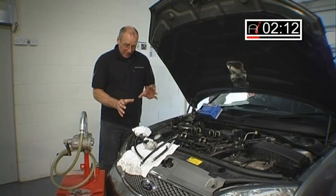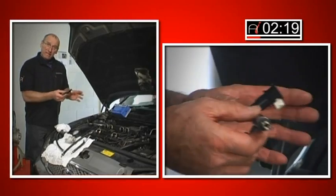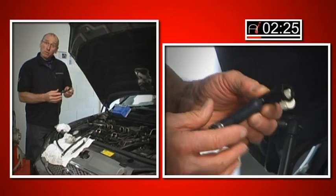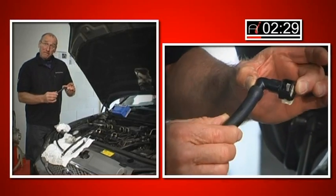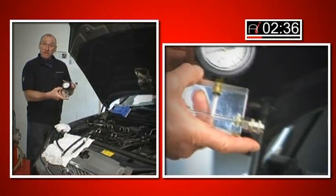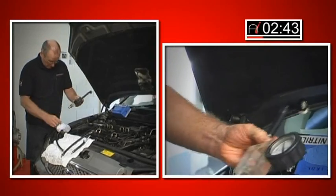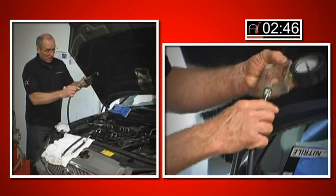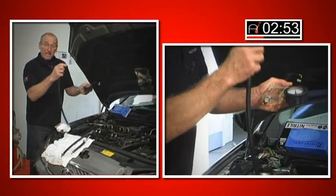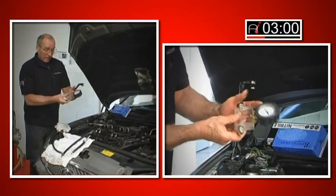We then had to get together a series of fittings. The consideration was that the quality of the connection to the relevant vehicle — this is a Ford Mondeo — matched the OE quality. So quite simply, what we did was buy the original pipes from the manufacturer and then convert them to our self-sealing couplings, which, together with the various gauges we use in our analysis and diagnosis, means all the gauges, no matter what we connect, are all simple, airtight, hands-free, quick-release, and self-sealing couplings. Basically, we can interconnect virtually every tool for fluid measurement that we have in our inventory.